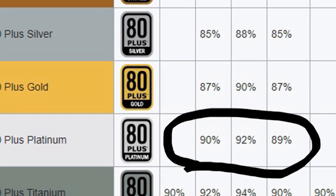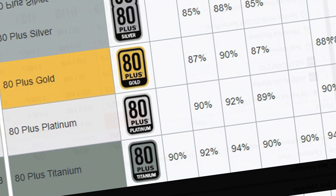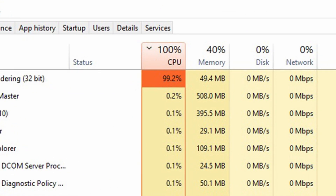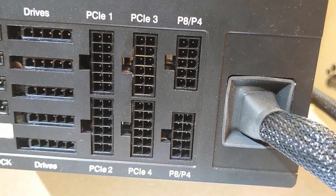This ensures I have enough power for this device, as well as giving me cushion if I add more components. I chose the Platinum level as it gives good efficiency — it might generate less heat, and it should save energy in energy-expensive California. I use a lot of power for my 3D rendering, so I want efficiency more for this computer than I'd normally recommend for most folks.